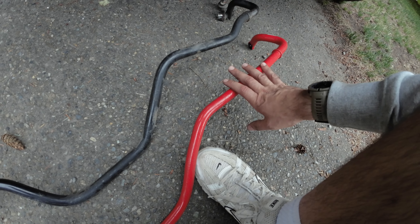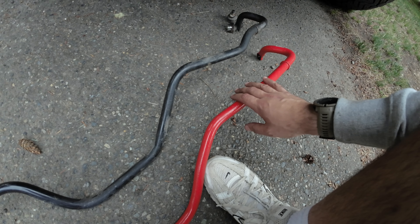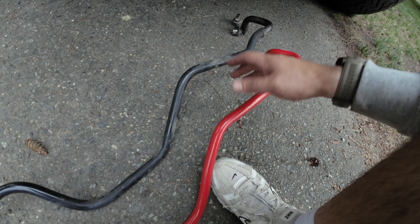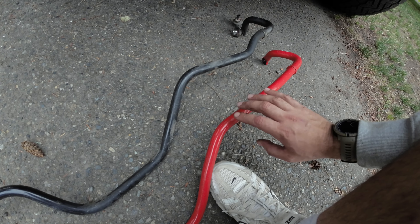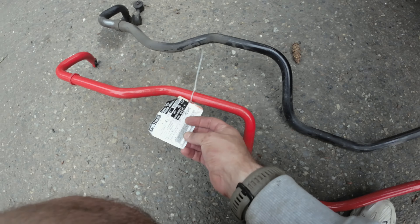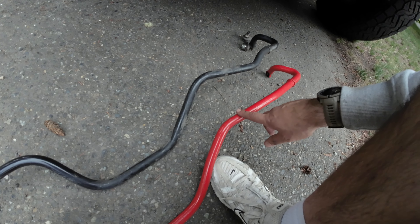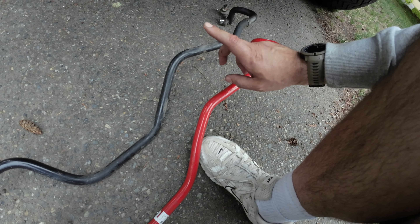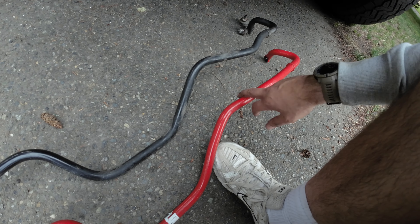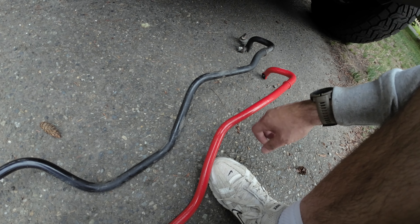I also want it to handle a little bit better on the street — I just don't like how it's so tipsy all the time. A rooftop tent doesn't help, but a Sequoia jacked up on 37s, let's stiffen the rear a little bit. That's the difference between the TRD bar and the factory bar. Now that we've gotten everything tapped out and cleaned the threads, hopefully they hold — I'm going to get some red Loctite so the bolts don't come undone, and let's throw this bad boy back on the car.